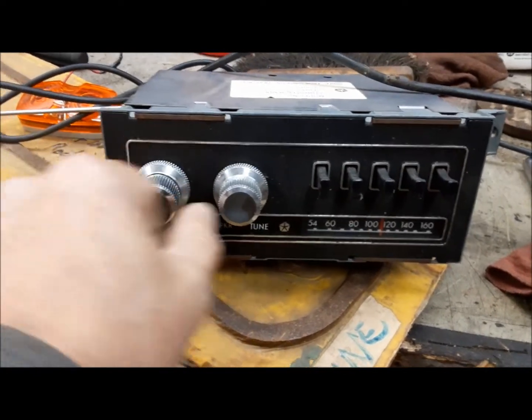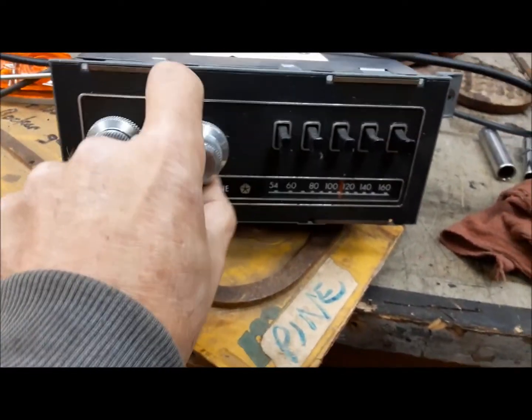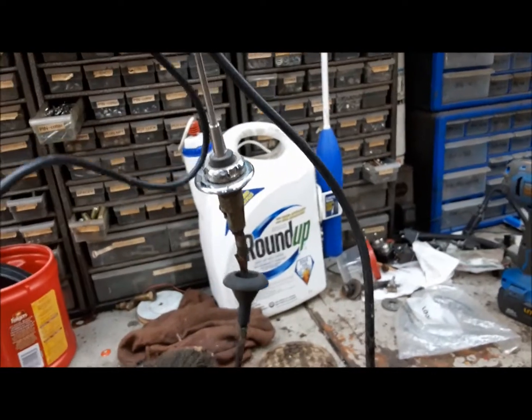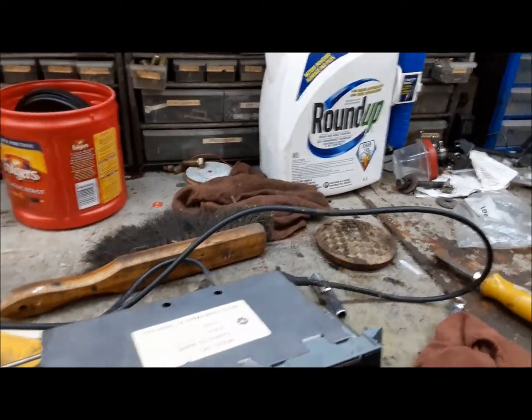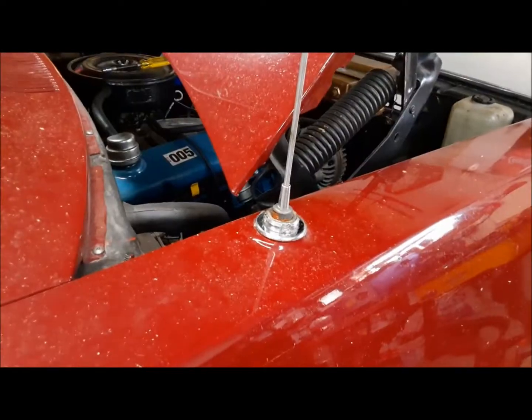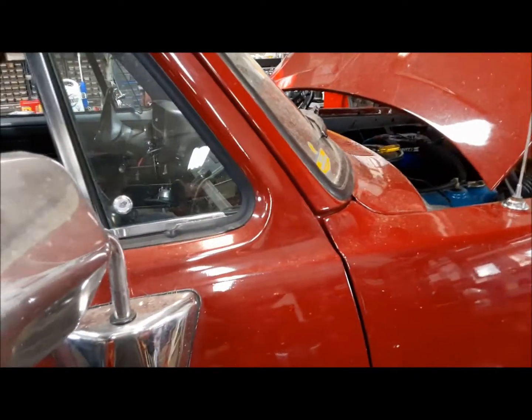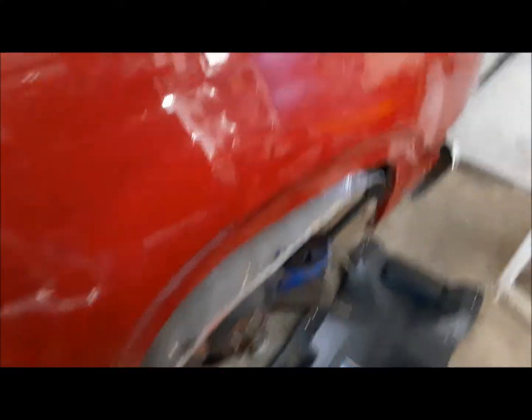I found this nice factory AM radio — it's got a fader so you can use a rear speaker with it. And I found a factory antenna because this one has a broken aftermarket one on it. That's a lot nicer now. I've got a nice factory-style antenna in there. I did have to drop the inner fender to get in there to work on it, but no worries really because the truck just isn't rusty. Look in there — it's not rusty. The bolts all came out quite easily. So we'll put her back together and fish the wire through the dash and get our radio put in.